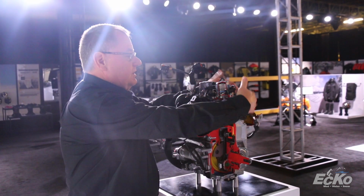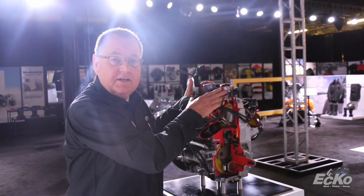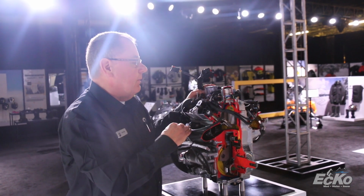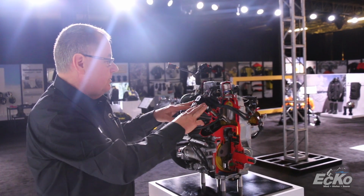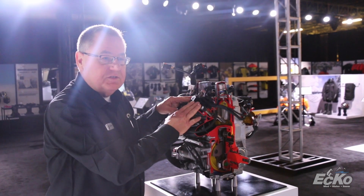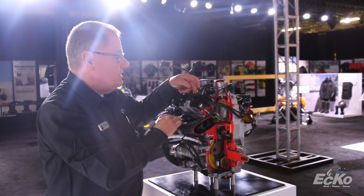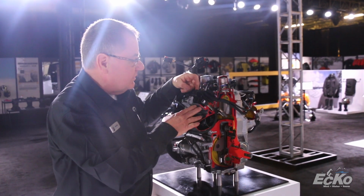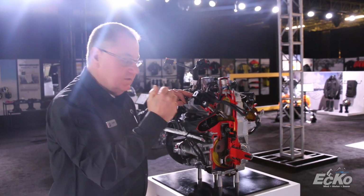If you're cruising, these injectors don't work anymore, and we're just running on these more precise direct injectors, so we get the fuel efficiency back that way. But the responsiveness of this motor is incredible. Also, the new RAVE system is an electronic cable-operated RAVE system, so it's 3 times faster in response than the pneumatic system that we had before, yet we retain the sensor that feeds back and lets the ECU know exactly where the RAVEs are all the time. So we have a lot more precise control of the RAVE valves, and again, we get that instant throttle response from that.